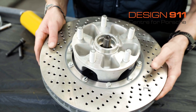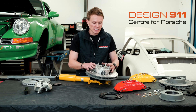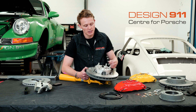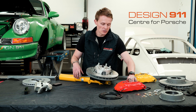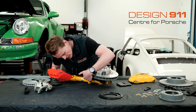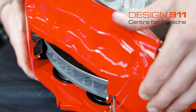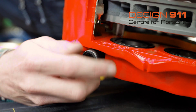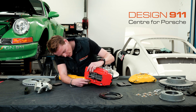Now you'll be ready to put on the sub-assembly that you created with your brake disc and hub. It will be a much tighter fit — this assembly doesn't have any bearings in it; the bearings are working on the stub axle. Once that's on, you can then put back on the clamping nut, do it up until all the play in the hub is removed, and then do up the locking clamp. Once the locking clamp is done up, you can put the cap back on. The final thing to do will then be to install your brake caliper — this mounts onto the caliper hanger adapter and slides over the brake disc. Take your fixings for the caliper; they go through the holes and straight into the holes on your caliper hanger adapter.